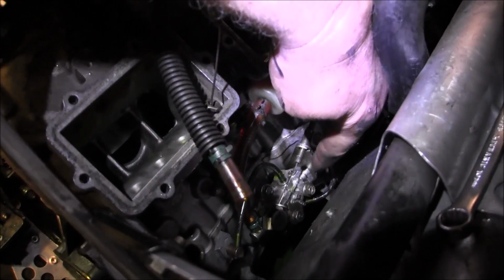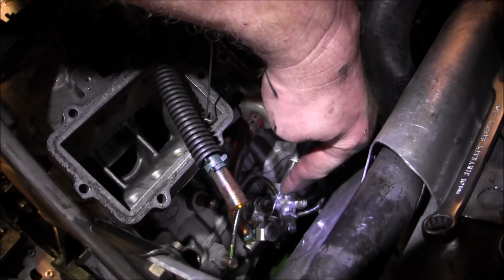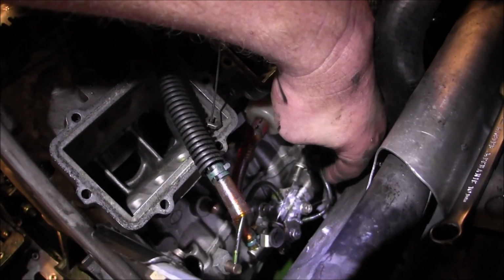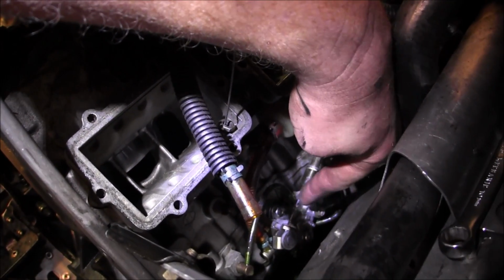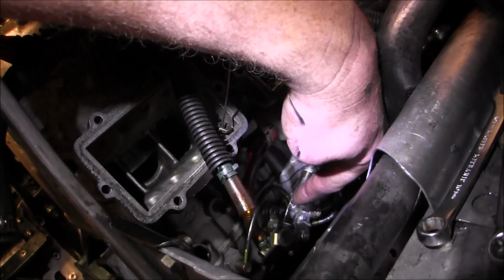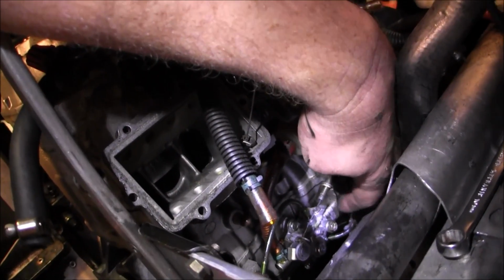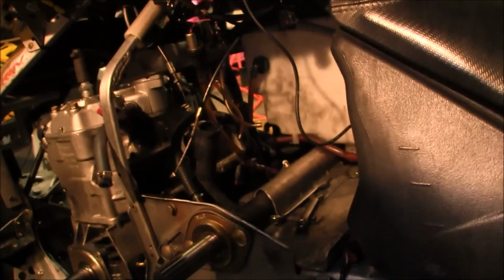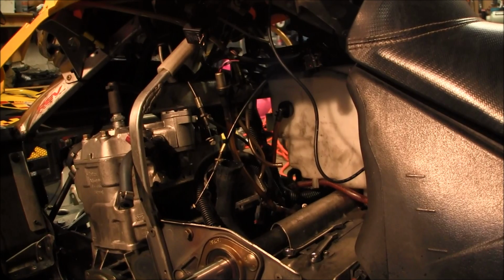So you must have to adjust this plate to get the right tension on this cable. Pretty much just bend that plate. So I guess what I'm trying to get to is, you should make sure that plate is in the right spot, bent, so you get the right lash on your oil injector. Make sure that plate's pretty right. Roger, 10-4.